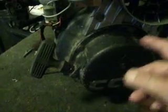And what I did too was I took the screws that hold those in place and I backed them off, and I shot a little carb cleaner in behind the screws and stuff, and I backed the screws off, and then I tightened them back up. Make sure they're getting a good ground and stuff in there.